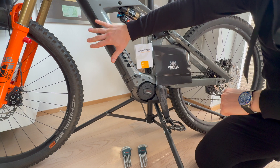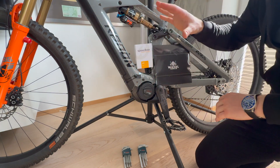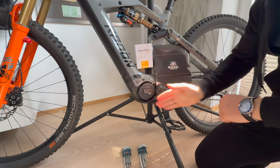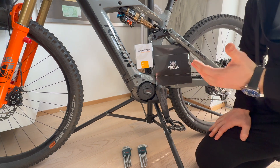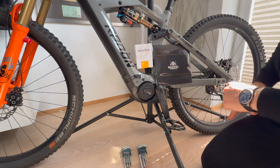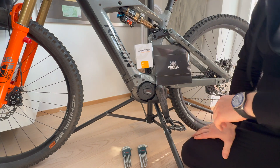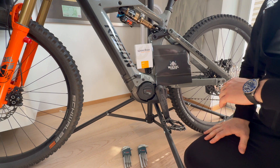In this video I will show you exactly how to open the motor and battery covers, which tools you will need. Here we have a Bosch Torx and the Bosch Allen keys, and possibly how to remove the pedal crank if necessary — for some models that is required. We also have a bike stand here, which just makes it easier to work at a comfortable height without lying on the floor.